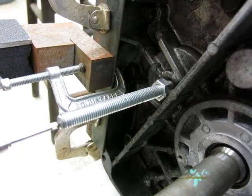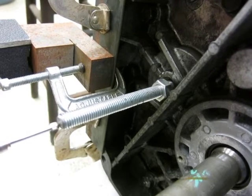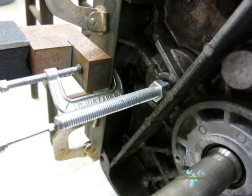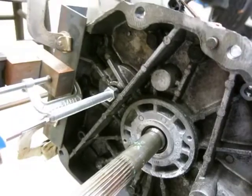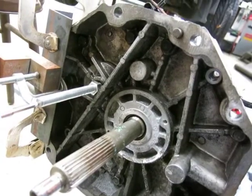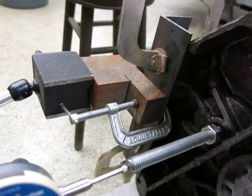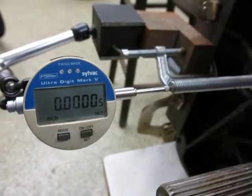The first thing you do is take out the shims that are in the transmission. The shims are removed, the races are reinstalled, you assemble the counter shaft, the input shaft, and the main shaft. I put in six to eight bolts, just snug them up to set the clearance. Then I have this Rube Goldberg set of clamps and steels and my metrology indicators to help me measure this.